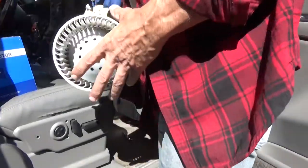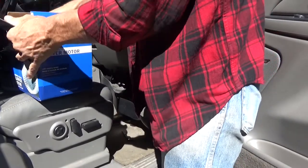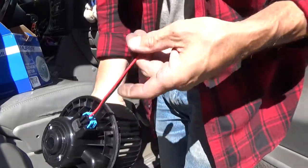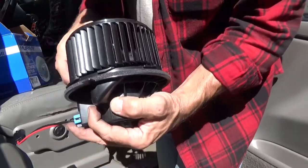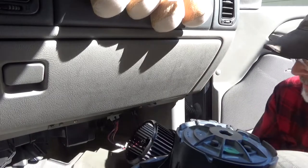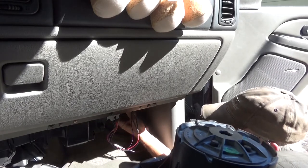The owner came back — the old fan still has a tab on it. The new one comes with a plug already wired into it and a black squirrel cage. There's that tab. So we're going to go put this up inside the vehicle and be done. We've removed the wire from the bottom of the fan, and we'll take the fan, slide it up in here, and get it lined up with the tab.